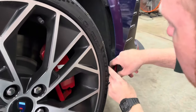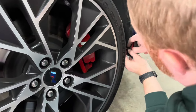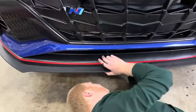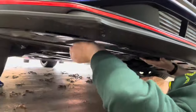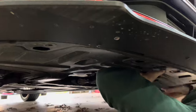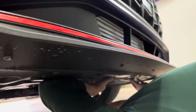After installing the intercooler, I took the car out for some spirited driving. I noticed the car ran cooler — around 15 to 20 degrees cooler than normal, depending on my driving. I also noticed better takeoff performance from the car. The intercooler does provide additional horsepower without the need for a tune, but not a lot. Even though the power gain was small, the car definitely had better takeoff, especially as the RPMs increased, which was noticeable.